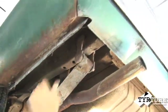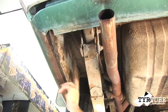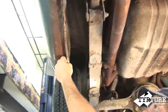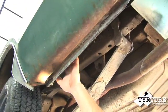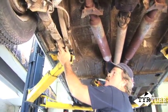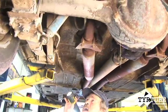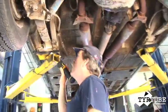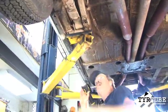Where the bolts go through it's double-paneled in there, and that's usually where the rust starts. These drop-off panels right here actually tie to the bottom lower half of the quarter panel — when the lower half of the quarter panel is rusted gone, those are usually rusted gone too. Right here where your front leaf spring bolt goes through is usually not bad because they're galvanized from the factory, so it takes a lot for them to be rusty. If they are rusty, the car's got rust everywhere.